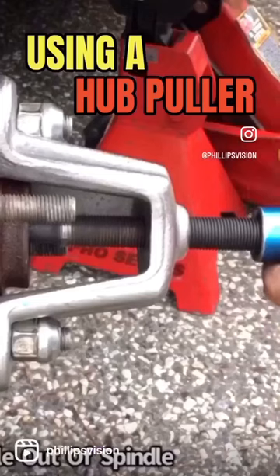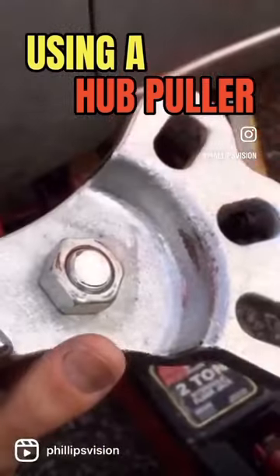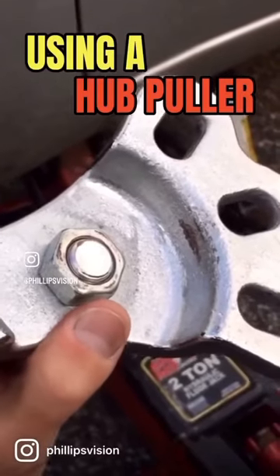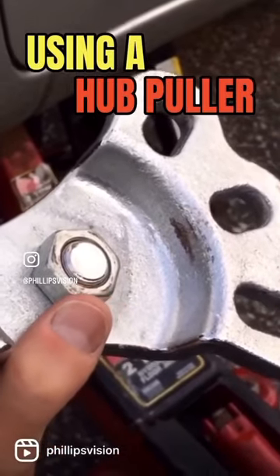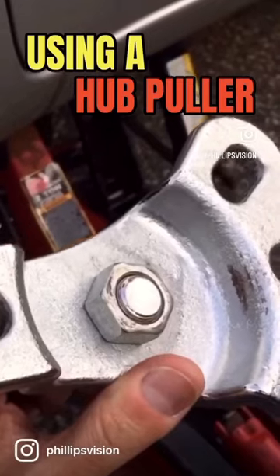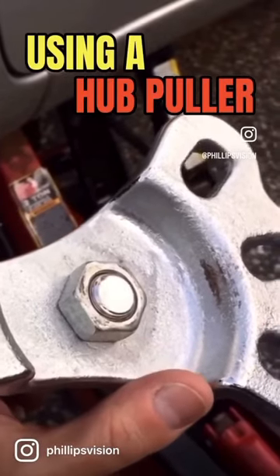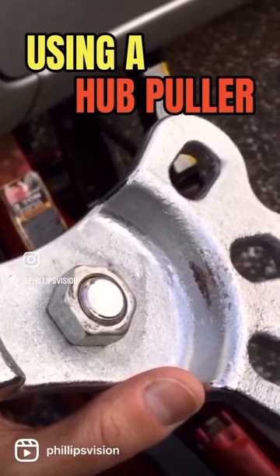I have a kit that I bought. I went ahead and removed the lead screw and put the slide hammer rod into the adapter. Make sure that you always tighten that with the nut so it's nice and secure. Now that we have this all set up properly, let's go ahead and connect this to the lug nuts on the hub so we can start using the slide hammer to bang it out.